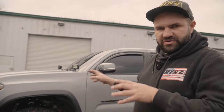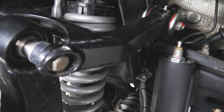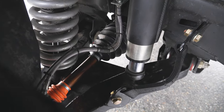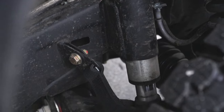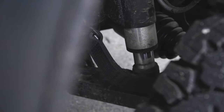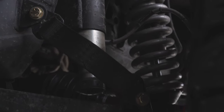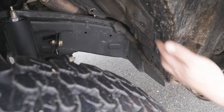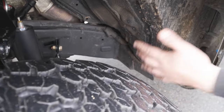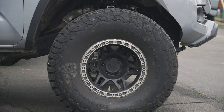In addition to the Marlin Crawler kit, we installed these massive Rad Flow bumps. This is something you will see on full-on buggies and crawlers. The customer had a set and we decided to make it work, so as he goes to terrain, these things definitely put in work keeping the truck nice and stable. Even though it has 37-inch tires and a wider front suspension, we made all this clearance and got away with it with only a cab mount chop — no relocation needed, no firewall tubing, none of that. This is all pretty much stock clearance, all because the front suspension is moved forward a couple of inches.